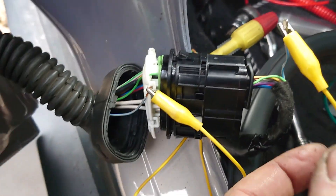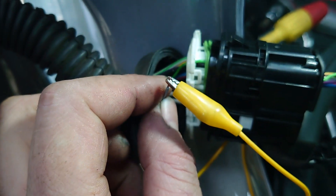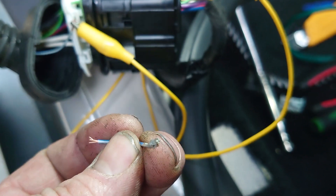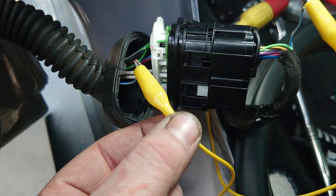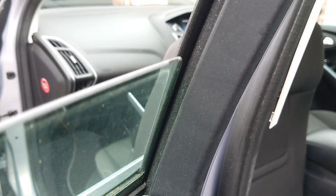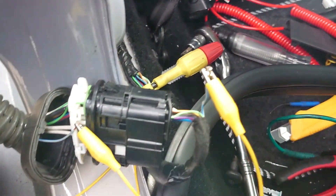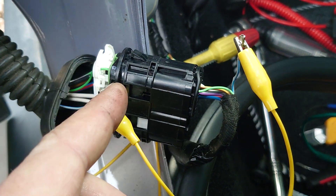Just to make sure there's nothing else weird going on — I've got the wire, what's left of it, out the back. It was rotted. I put a jumper cable from this side, plugged it back in. Upward and downward window motion works, and the central locking works as well — I've checked that. So realistically it could do with a new loom from there outwards.